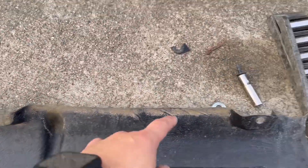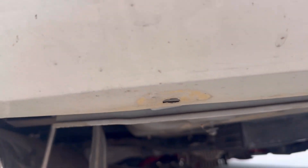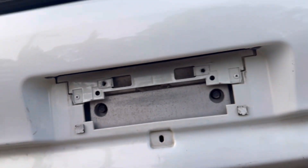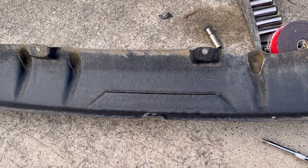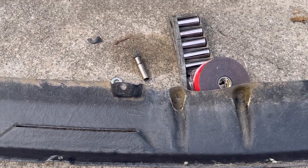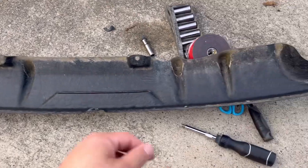This is held in by a bolt that goes here, and then you've got these two underneath the bumper — one is there and the other one's there. Those are plastic tabs, and those don't actually use a bolt that threads in. So let me go ahead and lay down the double-sided tape on the diffuser.